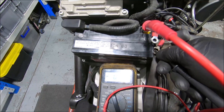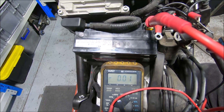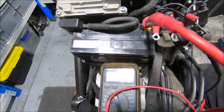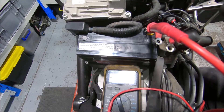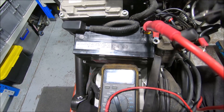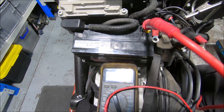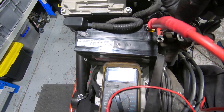I'll try his little battery tender — once again, no current draw there as expected, or as hoped. And this is the main power wire, so now we should see a draw here because the dashboard will draw power. The ECU might draw a little bit of power. We'll just hook it up and see what we get.